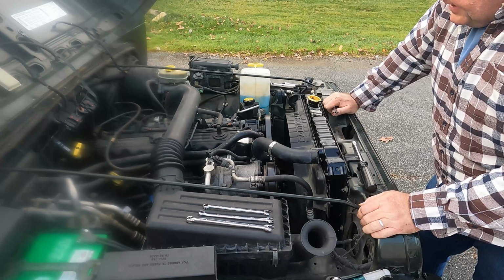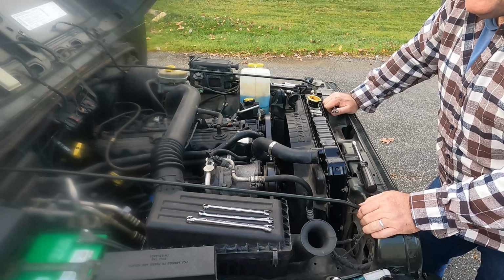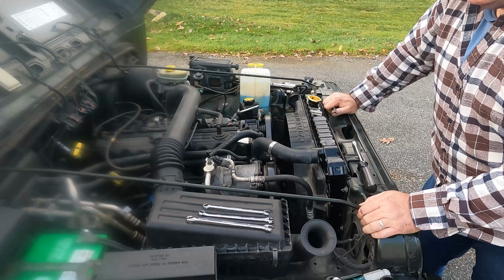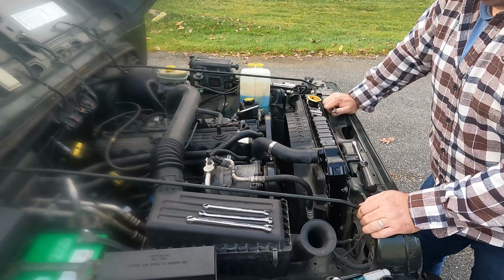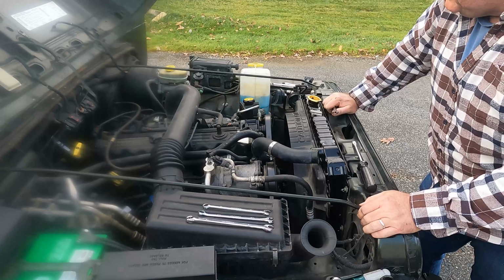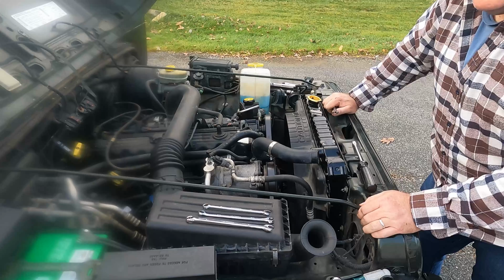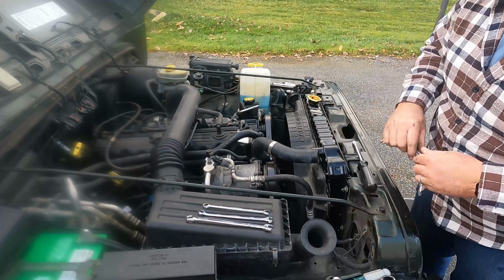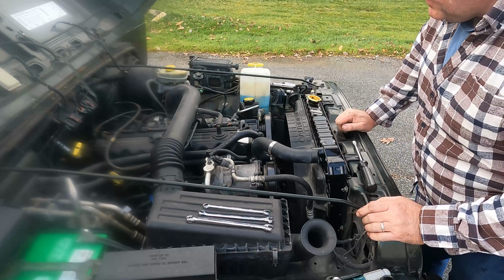But if you have what seems like overheating problems after you install a radiator or really any device in the cooling system, chances are probably pretty good that you have air trapped in the system. And this is somewhat of a closed system. It is a closed system, so you got to get the air out or it won't go anywhere. It'll eventually maybe find its way into the top tank of the radiator, but maybe not. So I'll show you how to take care of that when we get that far.